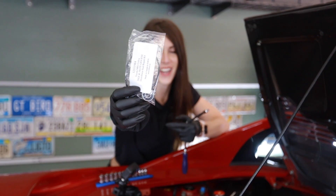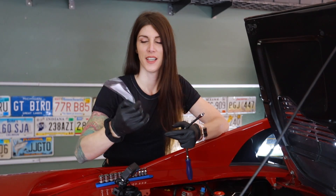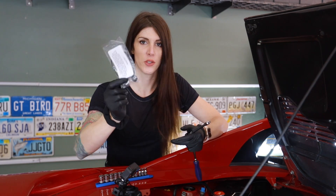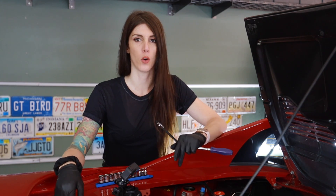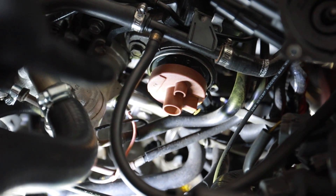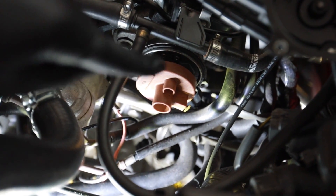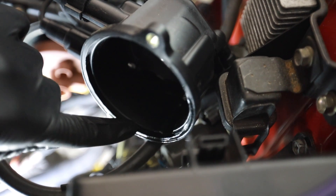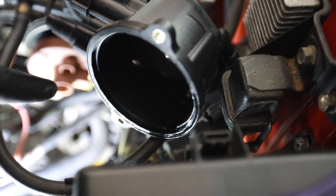So this right here is a kit I got from 2zarus that lets you rebuild the distributor on this car, because you can't buy this from Toyota — they make you buy a whole new distributor. Not even two videos ago I just replaced this cap and rotor, and I told you guys about the internal seal leaking on the shaft right on the backside of the cap. You can see right here on the inside where the gasket sits — that's oil residue already, and I haven't even driven this thing about 20 miles since doing that cap and rotor. So it needed this.